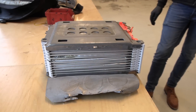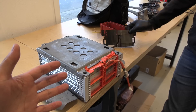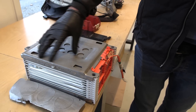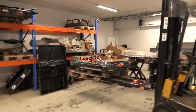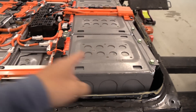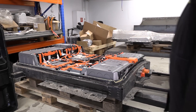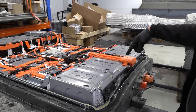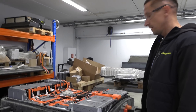It's the same as Nissan — it's tight, there is no or minimal air circulation inside. The heat somehow escapes, but it may have to pass through air, and the problem is that air is a really good heat insulator. With passive cooling, the cell gives heat to the metal frame, the frame is attached to the main battery case, which then delivers heat to the air. This battery also had two cells on one module, and that module has a slightly lower voltage, so I suspect it has the same dehermetization problem as the 40 kilowatt-hour battery.